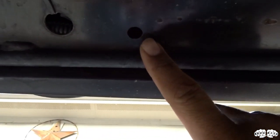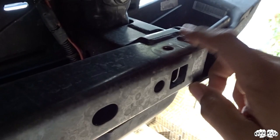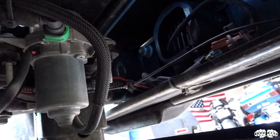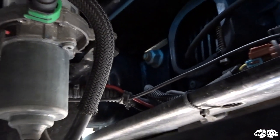So there were those four little clips that held the splash guard, but then there were also two more on the inside — one here and one here. Now there are going to be four bolts for the bumper: two here, and then the other two right there — one there and then one right below that. Those are gonna be a little bit difficult to get to. Then we also gotta disconnect the fog lights.